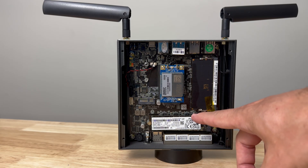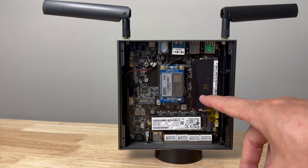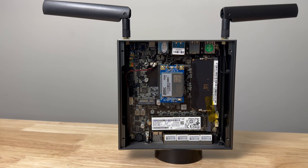I installed an M.2 SSD in there for the OS to live off of. There's also a 32 GB eMMC storage module on board somewhere in here. We can also see a cellular card, which uses an M.2 3052 B-key slot for the modem — I believe this is the LTE version, though you could put a 5G version in there. Up here we have an M.2 2230/3052 E-key slot for a Wi-Fi card.